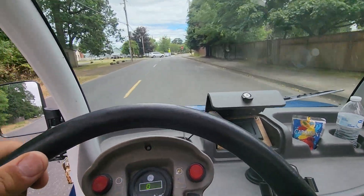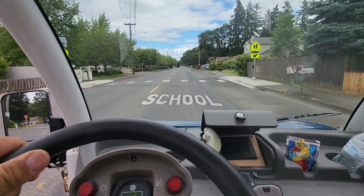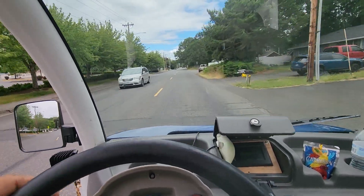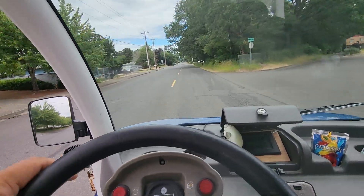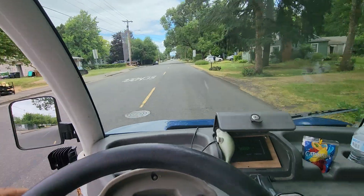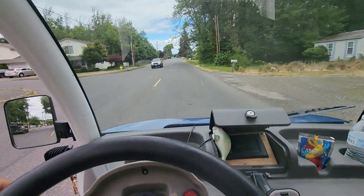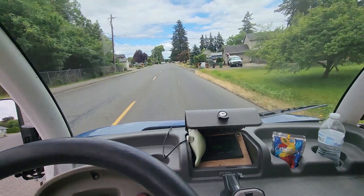I've been driving this thing all over since I finished the battery. It works great — I haven't had any issues with it. A fully charged pack is still under the over-voltage range for the GEM car's controller, so we're still good there. I just can't say enough about how happy I am that it's working out. The weight over the front wheels is something I like, though I realize not everyone can do that with their GEM car.